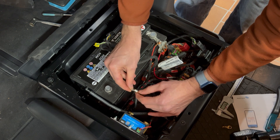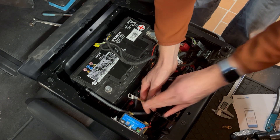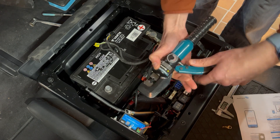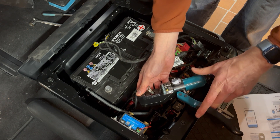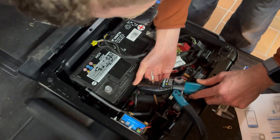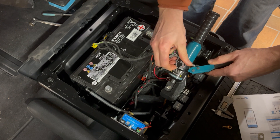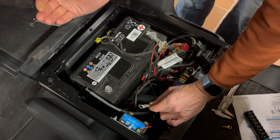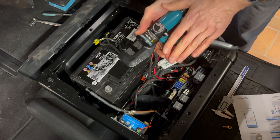Fit the new terminal on, making sure all the copper is seated in. I'm using this crimping tool — the other one I had didn't work so I bought another one, and I also spent a bit more on German-made terminals rather than Chinese ones for a more professional result. Let's make sure the cable is fully seated before crimping. Compressing on the metal now — once it stops compressing it won't achieve anything more. That's not coming off for anything. The other tool had no chance; this one worked much better.